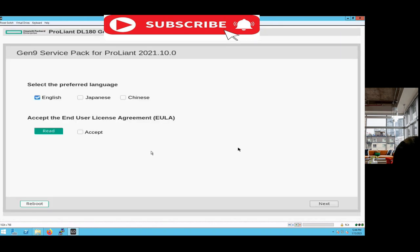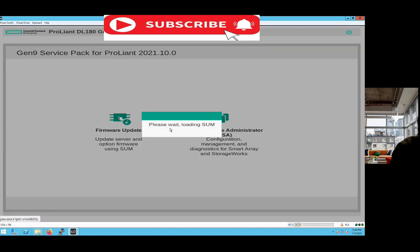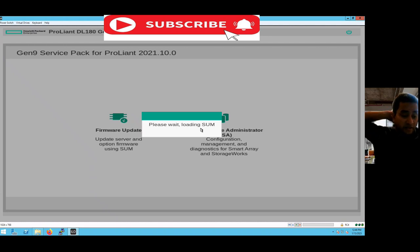Okay, now you should just click on accept, click next, and firmware update. What is the smart storage administrator option for? If you want to configure the RAID system, the disk RAID configuration, you should go there. But I'm not doing anything with this. I'm doing the firmware update, so I'm going to click here. It says please wait, loading. It will take a little bit of time. Just wait.